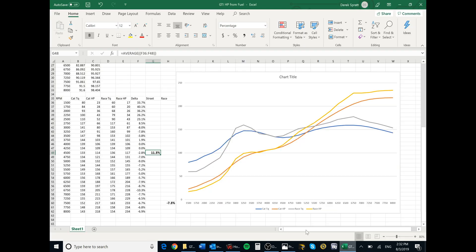I've got a chart here showing the power of the car with and without the catalytic converter. The gray line is the torque curve — it's a bit bumpy, produces almost no power down low, then at about 2,500 RPM it surges dramatically to a torque peak at 3,200 RPM, and then to another torque peak up at 6,000-plus. This is when the cams are really working. This is an artifact of the headers and exhaust system creating a resonant peak, which actually corresponds with a groaning resonance in the car at highway speeds when you're under throttle — it howls a little bit and isn't that pleasant.